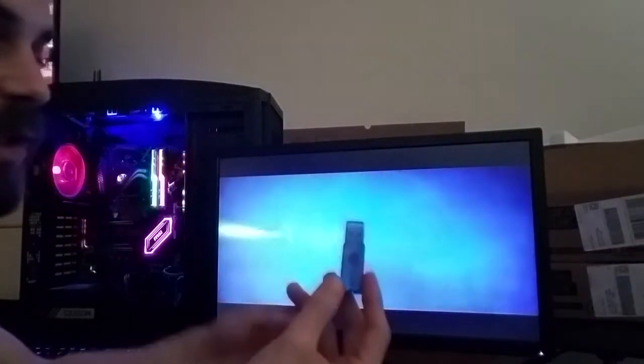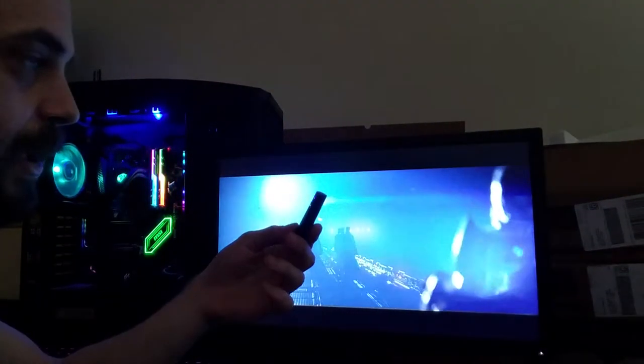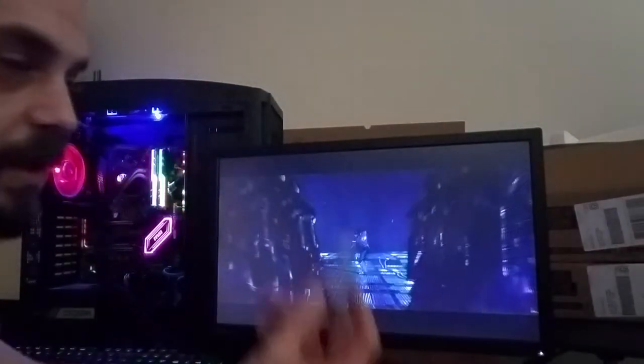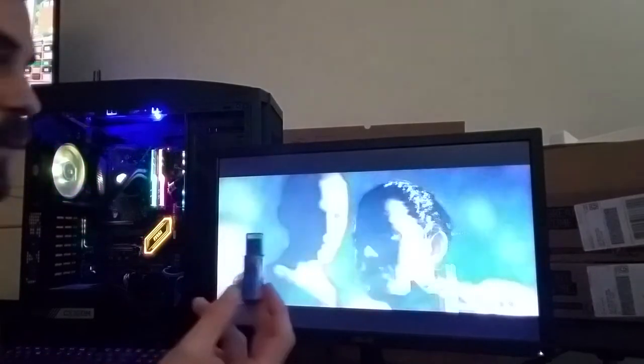And it's honestly just easier to have 2 of them, because then you can keep this as a backup in case Windows ever messes up. Just leave Windows on here by itself, and that way you can repair Windows from this USB. And then for this USB, clear it, make it completely empty with nothing else on it. That's where we're going to put the BIOS update.